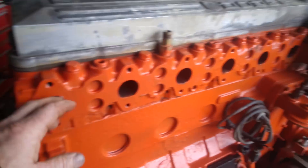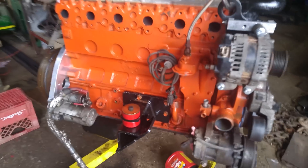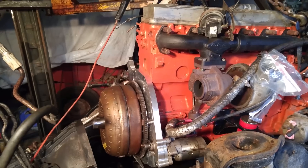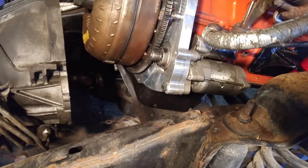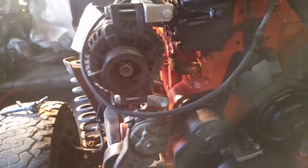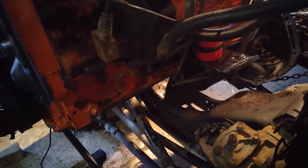Next I'm going to stick the new intake and exhaust manifold on with the turbo, then stick the motor in. The problem we've got is that the oil pan is pretty tight to that front cross member. Everything seems to be fitting alright — motor mounts are installed and they're just going to set right on the frame.